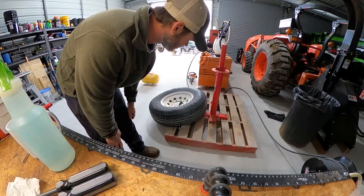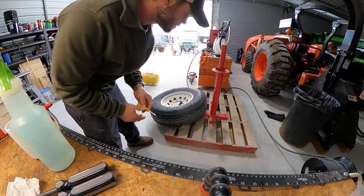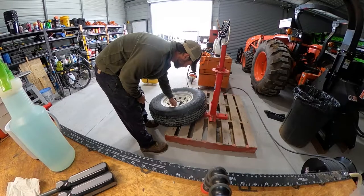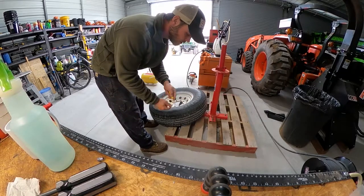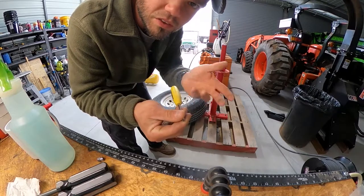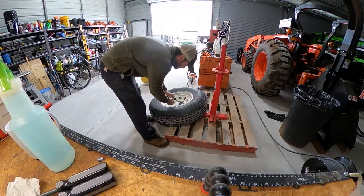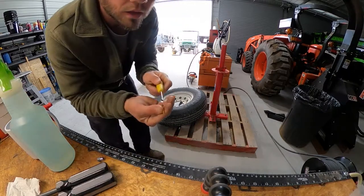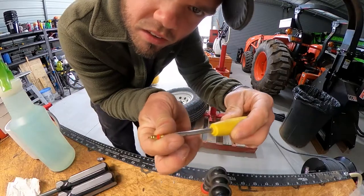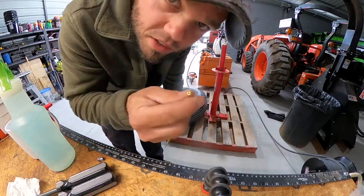The first thing we've got to do is break the bead. In order to do that we have to get all the air out of the tire — that's where the valve stem removal tool comes in. You just take your cap off and slowly unscrew it. You want to keep the valve stem core that you take out. When you start to loosen it, that thing is going to blow out because of the air pressure inside, so you just want to use your hand and catch it. It comes out and blows out — just catch it and set it on the table. Keep it clean whatever you do.